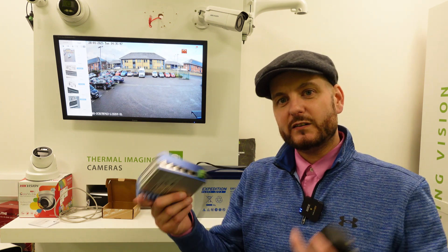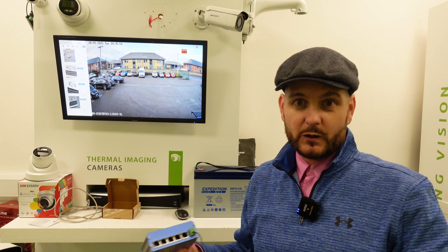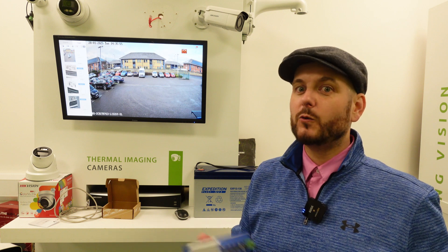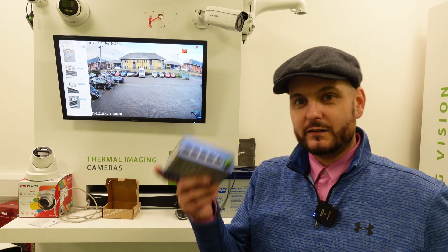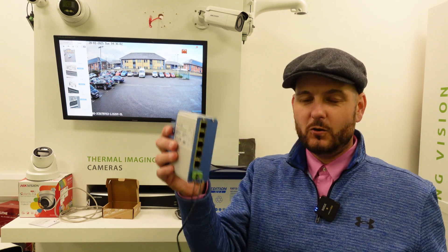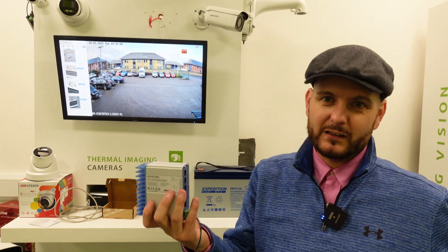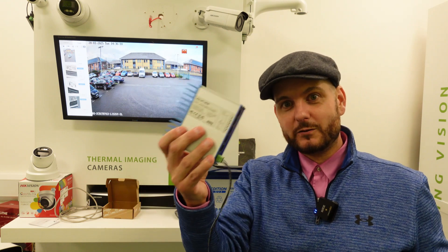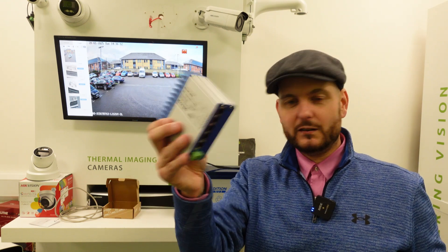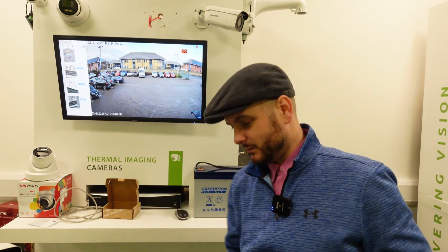This is great for vehicles, and because it has that wide range from 8 volt to 40 volt, most commercial trucks and cranes operate on a 24 volt DC system — this will still work fine. So 8 to 24 to 40 volts, all fine. From standard vehicles to industrial heavy duty vehicles like trucks, cranes, and heavy industry vehicles, this will allow you to install it and still be operational on the battery harness of that vehicle. Super, super flexible.